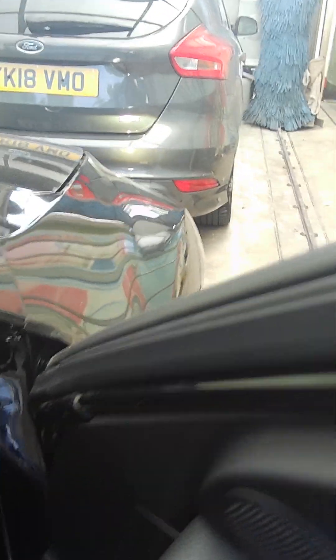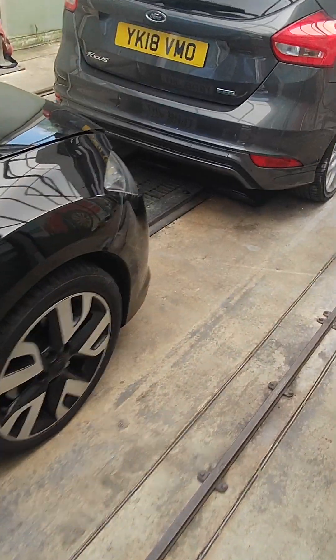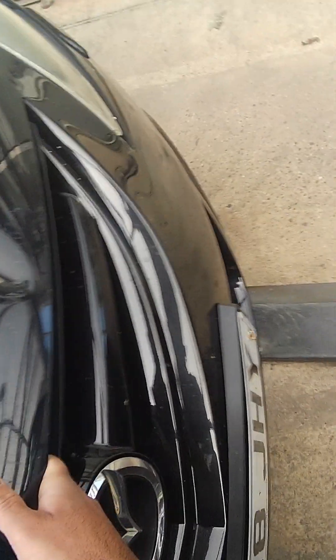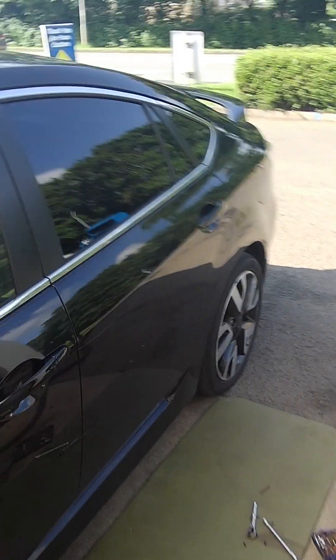So what you have to do in this case is open the bonnet. For the Mazda 6 you have two fuse boxes in this shape. One of them is located just under the bonnet right here, the other place is also there. That's all - you only have two fuse boxes. So what you have to do when you don't have sound is check those.